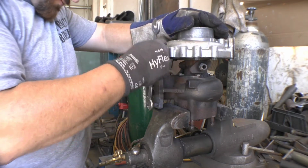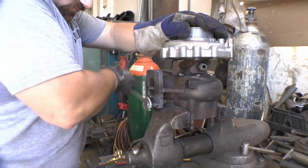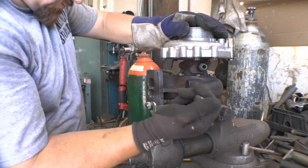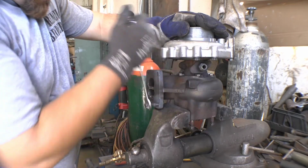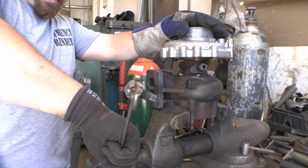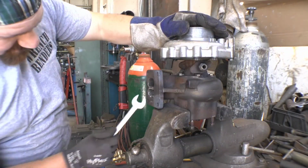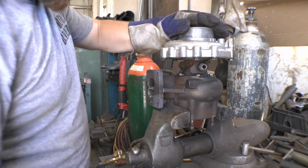Also, even though it looks strenuous and kind of like it would help the process, don't ever put a ratcheting wrench on anything that you're applying heat to. Yeah, might end up bad for the ratcheting wrench. Unless you got like an extension. Now look at there. There it is. There's number 2 out. Kegan, don't touch that. It's hot. Adam, you're not at him. So, that's done. Good deal.